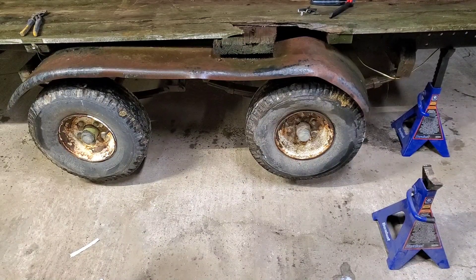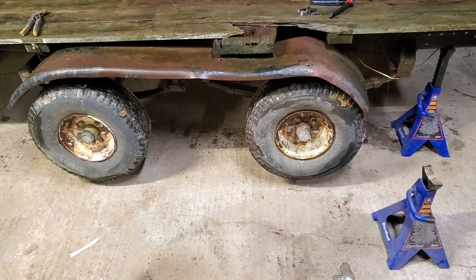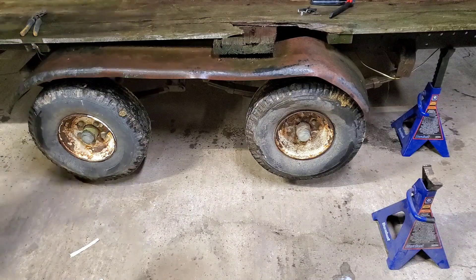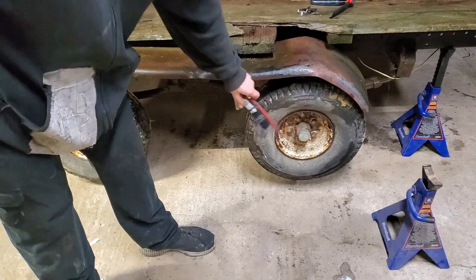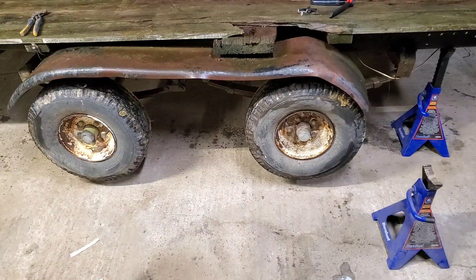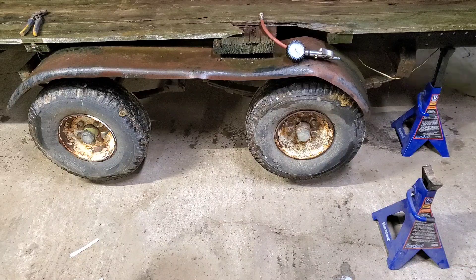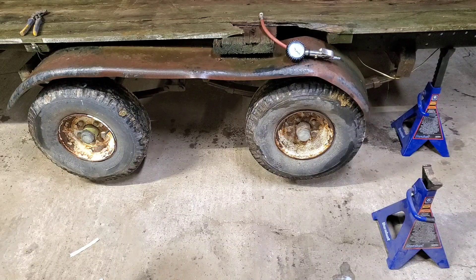This back tire is the one I showed you outside — it may not be good. What we're going to do is fill it with air, then take the hub caps off, check the bearings, probably pull the whole hub, pull the tires off, and go over everything to make sure it's in decent working order. This thing sat for a very long time, and for that reason we're doing what we're doing. I've got a job coming up and we need the trailer for it, so we want to make sure everything's in decent shape before it's time to start working. I'm going to kick on the air compressor so it's going to be loud.